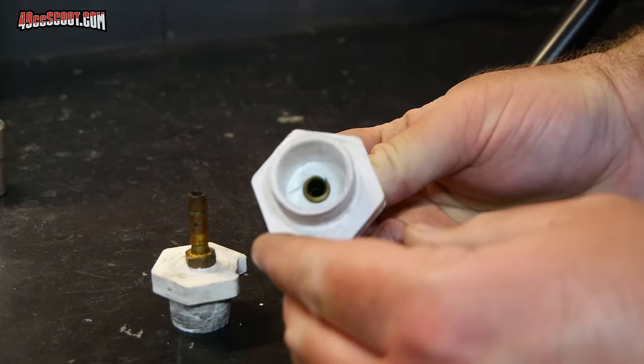The leftover RTV on this plate will clue you in to the other way I've used it — simply coating it with sealant and then bolting it up to the exhaust flange. That usually seals just fine. The major drawback is that you have to wait for it to cure, so you can't just bolt it up immediately. Whereas with rubber, you can just bolt it up and it's ready to go most of the time.